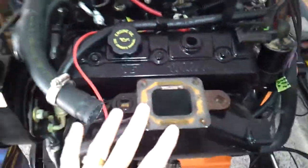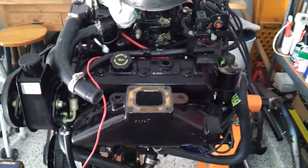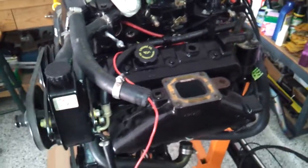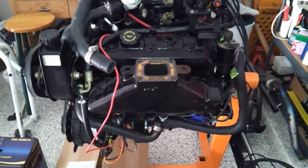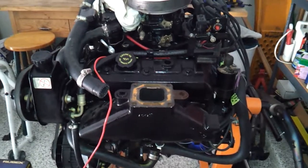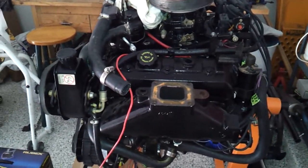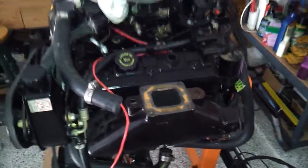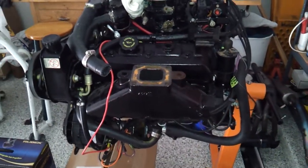I did a pressure test on my engine before pulling it, and all the cylinders were pretty good, around 150, 160, except for my number three cylinder on this side, which was about one fifteen, one twenty average. So that's obviously where the problem lies. It's probably a blown head gasket. Normally you get two cylinders that are low because the head gasket's thinnest between those, the biggest place and most prone place to leak. But for whatever reason, it's just number three.